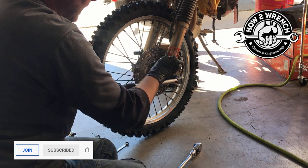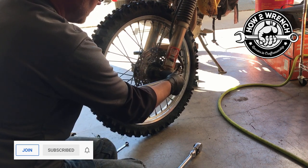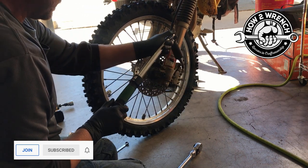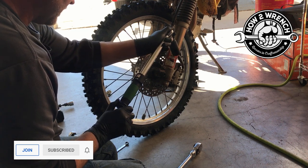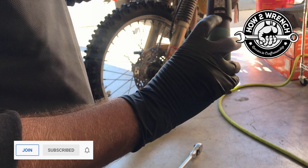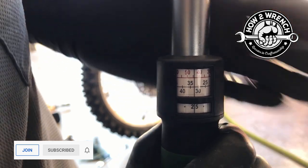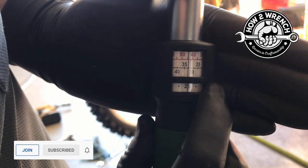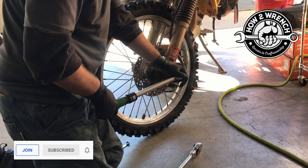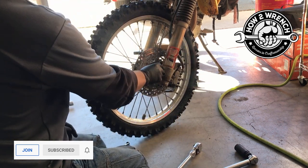It's really important to have everything clean — slide the axle in so you have a full grip surface. A dirty axle or debris in the dropout reduces grip. Setting the wrench to 32.5 — look at that, it even has a half-step mark. Thirty-two and a half, locked in. Boy, that feels great. Now I can pinch the fork legs down.